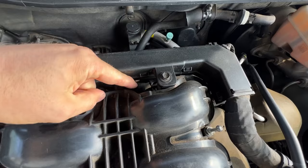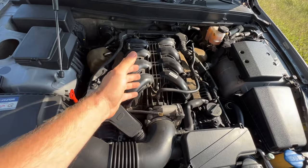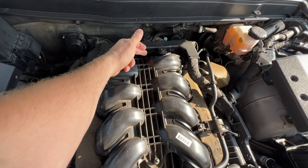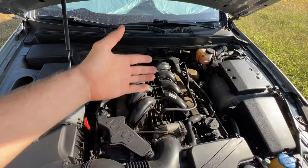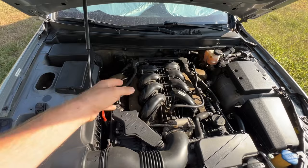So this is a manifold pressure sensor which has an air temperature sensor inside. And what is happening with this engine is when the engine gets pretty warm and hot, the intake manifold gets hot as well, as do the manifold air pressure sensor and air temperature sensor. So the manifold gets heat soaked, the air temperature sensor sees really high intake air temperature, and what the engine control unit does at that point is add way more fuel than the engine requires and retard ignition timing, because the ECU sees that intake air temperature is really high and tries to reduce the timing and add more fuel to be on the safer side, which at the end of the day results in higher fuel consumption